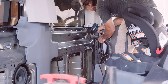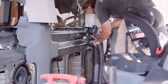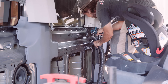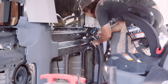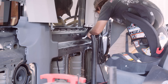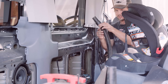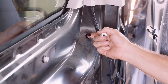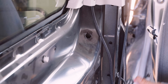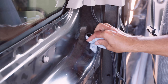I still remember my first time drilling a hole in a vehicle — it is not as scary as you think. Just think about where you're putting wires, and any holes that you drill for a pass-through like what I'm doing right now, make sure you use a rubber grommet to protect the wire that passes through it. Here I'm just using a cheap step bit from Amazon and then I coat it with some ultra black because I didn't really feel like using paint. But as long as you coat the bare metal after you do any cutting or drilling, you'll be safe from rust.